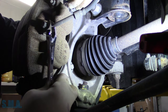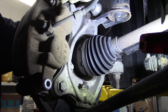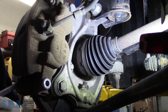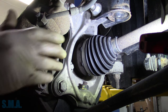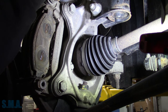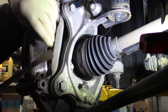Make sure your brake reservoir is not completely full. Now, I get a lot of kickback for pushing in pistons. I've been looking at a lot of manufacturers, and even on our great American Chevrolet, they state in their service data to just push the pistons in — no opening the bleeder, no monkey business.